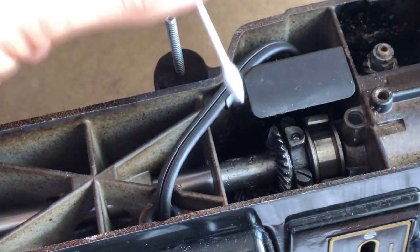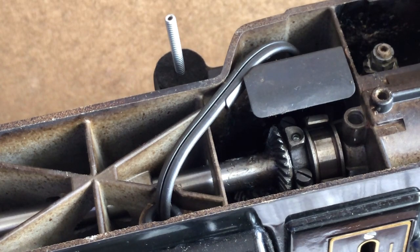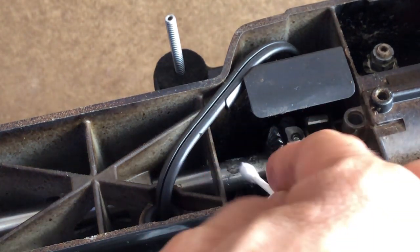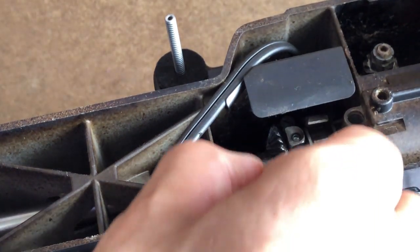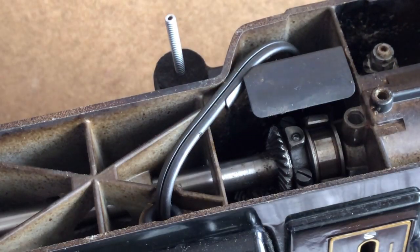You can clean that off with alcohol, then go back and put just one drop — and I do mean one — of sewing oil, spreading it around the steel to make sure you've coated it. You don't want to put that oil in the gear because the grease does not want to be diluted, not the way we did with the bearings.